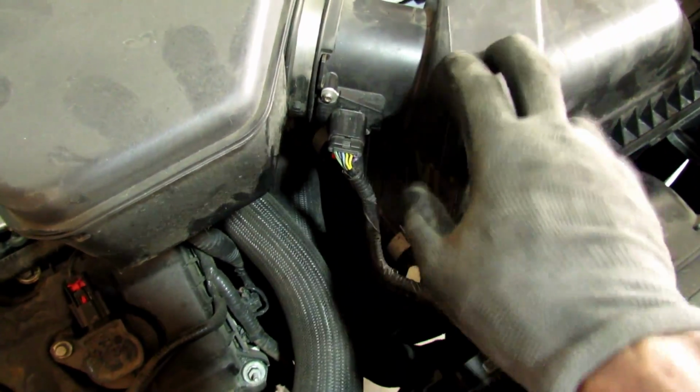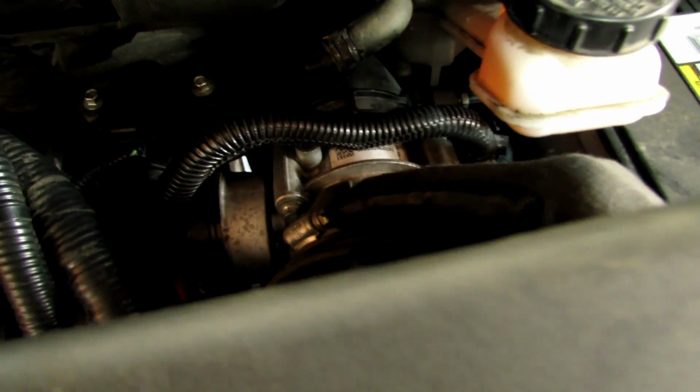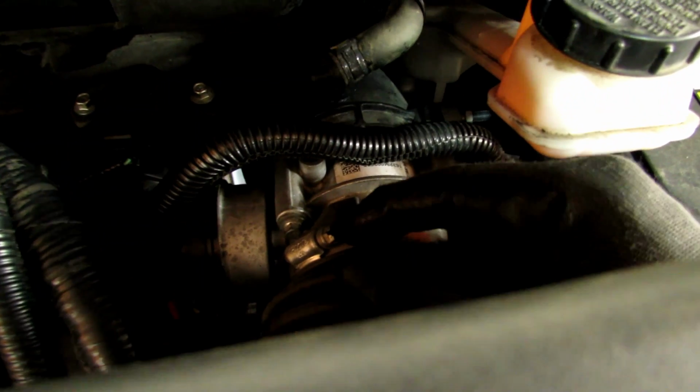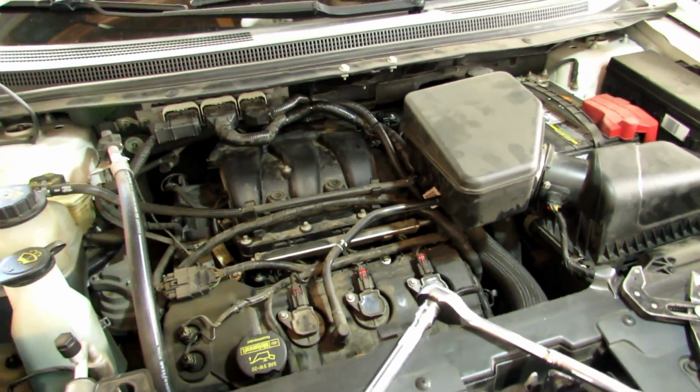Plug your harness in, take your other vacuum line, take the last vacuum line. Alright, you heard the clip. Harness to your air housing. There are little clips to check your filter. You have two. Here was the vacuum line that I was talking about. And then obviously, you can't see it, but just get a little screwdriver and tighten the clamp on the throttle body. And after that, all you have to do is put this shield on.